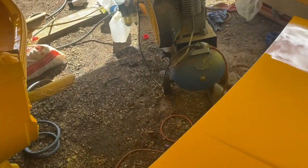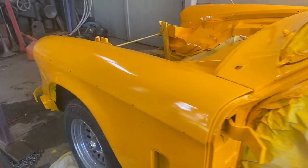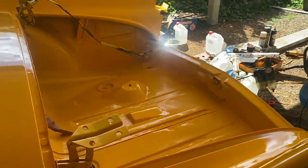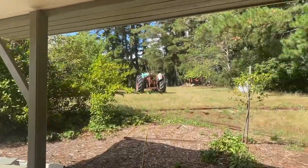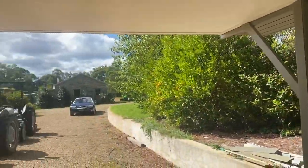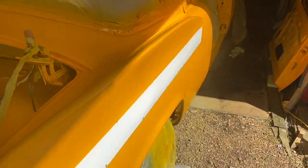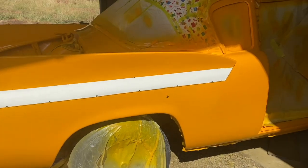You can see it's pretty good - particularly along the edge here it's really smooth. I'm really happy with how it's turned out. It's not perfect but I wasn't expecting it to be perfect - it's about as good as I could possibly hope for. This is my first time doing two-pack urethane without being in a booth. I had to wait for a nice still day - we've had lots of wind recently and this was the stillest day we'd had, though there was still a little bit of a breeze.